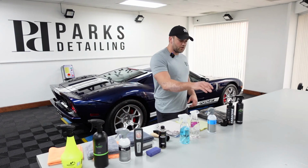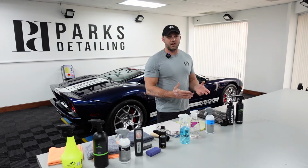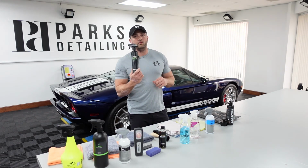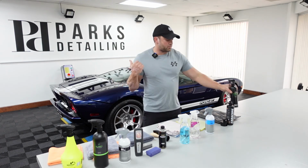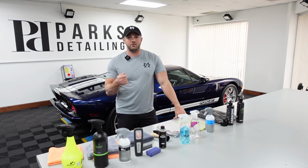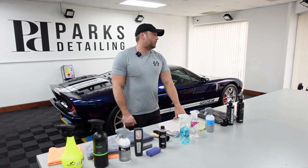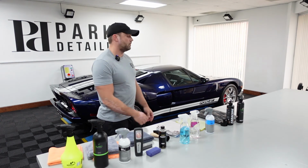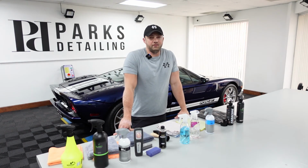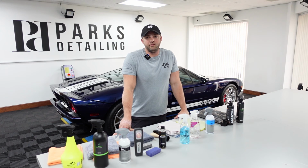So once I'm done cleaning the glass, last step is tires. I'm going to be using STEK tar and adhesive to prep the tire. So obviously we prep the tires outside using Siege from CarScope and a stiff brush, the Gyeon brush. They were pretty hydrophobic when I washed them, so there's clearly something on there. After cleaning it, it did knock it down by about 80%, I would say, but there's still some residue on there.